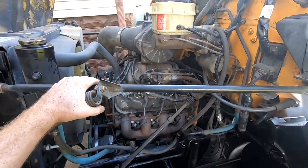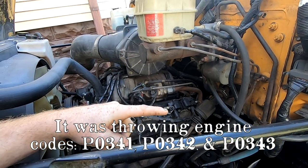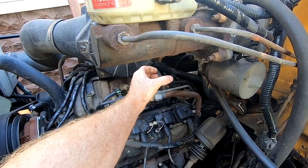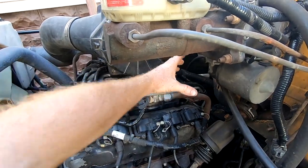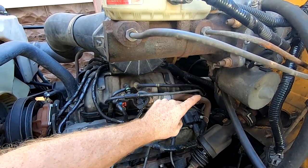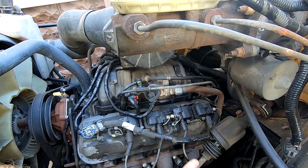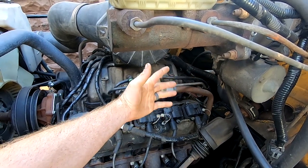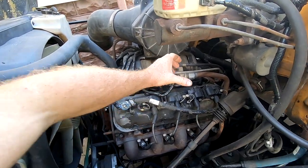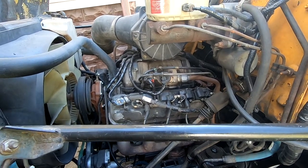Then the last thing that happened is I kept getting a sensor light that was basically a cam sensor light. It was essentially telling me that the motor was out of time. And so I ended up having to take the distributor back out, and a friend came over and helped me get it perfectly to top dead center again. Basically I had the distributor out one single tooth. If it's out even one tooth, it will fire and it'll run. It just won't run perfectly well. That was the situation I was having. It seemed to be running fine, but it kept throwing a code. And I didn't want to sell something to somebody with a major engine issue such as that. So once we got that distributor back in time and got that one tooth dropped right down in, the thing ran beautifully and hasn't thrown a single code since.